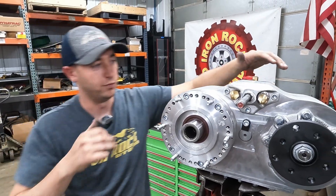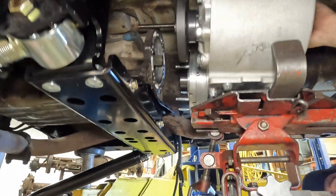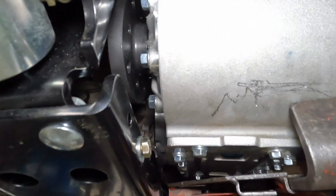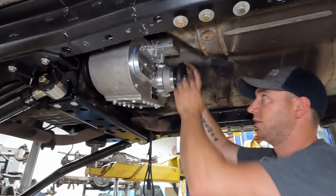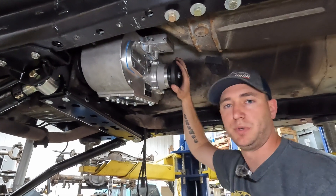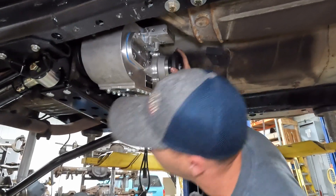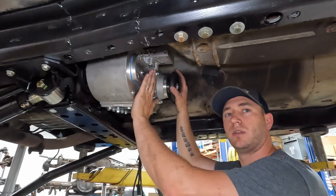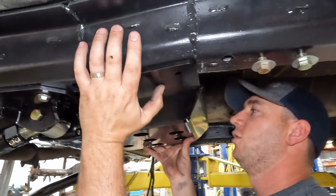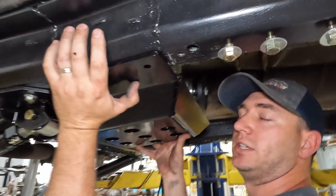Let's try this again. We've got it hanging — the top two nuts are holding it in place. Do yourself a favor: put it in gear before you start. When you're trying to get it up there and wiggle it in, you can just spin your rear output shaft to get your splines lined up — makes life easier than trying to clock the whole transfer case. We're ready to get our arms attached. Also, our existing 231 t-case skid plate will actually clear the Atlas on the XJ.